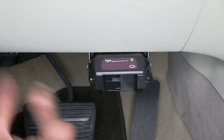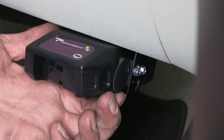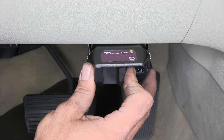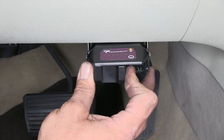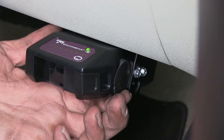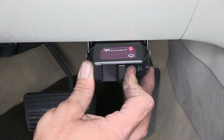The Voyager is a nice, simple, easy to use brake controller. Basically what we've got is power settings on the right side of the controller. For smaller trailers, or when our trailers are unloaded, we'll turn that sensitivity down to where we just barely have any change at all in the color of our light. As our trailer gets heavier and we have a need for extra braking power, we just rotate that dial away from us and that'll increase it. So we can fine tune this brake controller for whatever our trailer situation is.